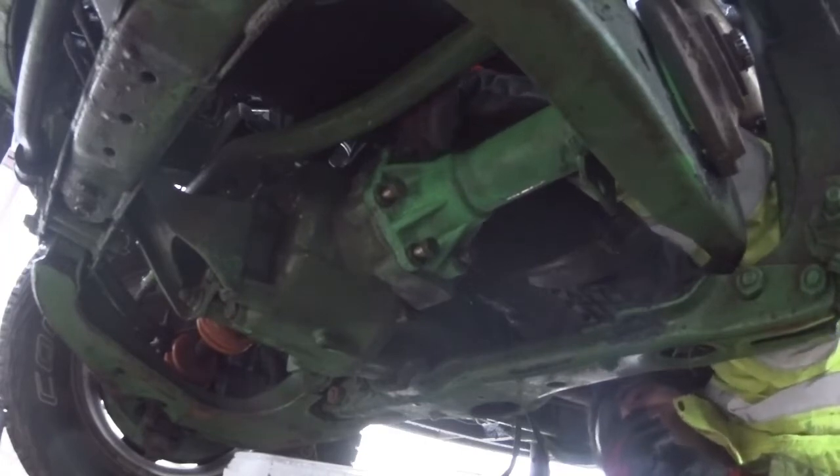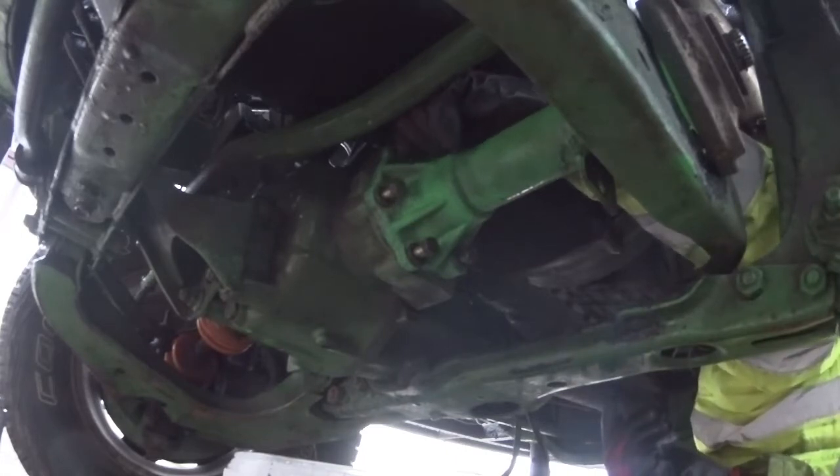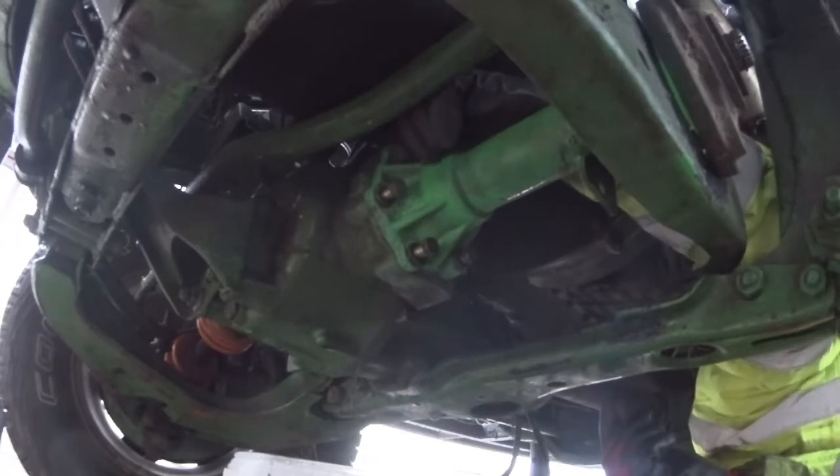Did we stick the pump on, do ya? You got a gasket? Yeah, it comes with one, don't it? You got studs in the block? Yeah. You cleaned the block? No. Get a razor blade and scrape the block.